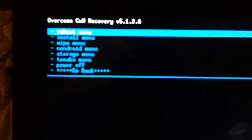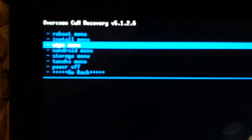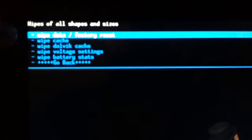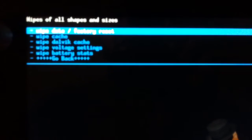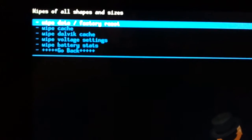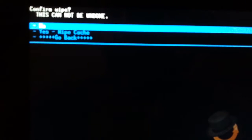Now, the reason why I like the way this is laid out — let's say you're about to flash a new ROM, so you're going to go to wipe. He's got it laid out where everything's there: factory reset, cache, Dalvik cache. Usually you'd have to go to advanced and then Dalvik. Not only is it all right here beside each other, but let's say I wanted to wipe my cache — there's only just a yes and no. You don't have to go back and use your volume button ten times just to get it to confirm that yes, you actually meant to wipe.